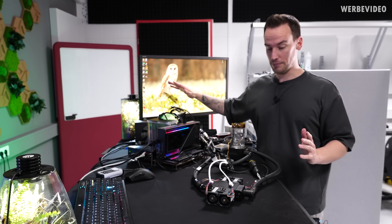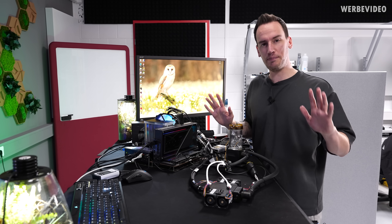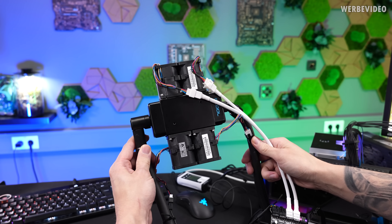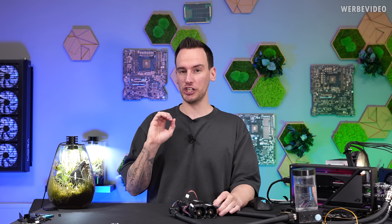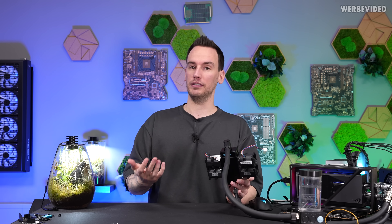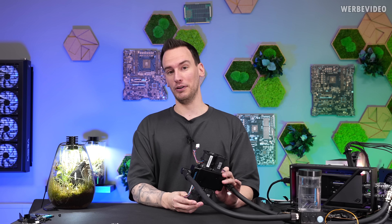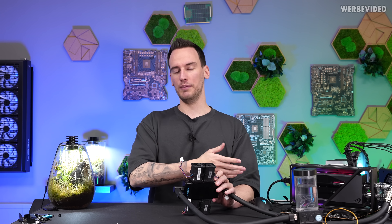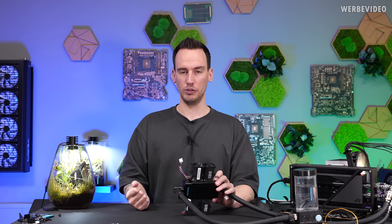I'm not sure what it was with the PSU, but subjectively it's not more airflow than before, so I think it's a good point to end this. Theoretically it would have worked with eight fans — basically four double counter-rotary fans on a small radiator for the 4090. To go back to the question from the beginning: with this radiator it seems that 450 watts are possible, but are they possible in a good way? Probably not. Can you cool an RTX 4090 with this? Seems like it. Is it a good idea? Probably also not — I wouldn't recommend it. Especially the memory temperature of 94 degrees Celsius: for a short 30-minute test probably not really an issue, but for a longer time period I don't think it's good.